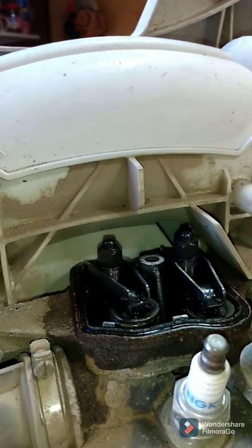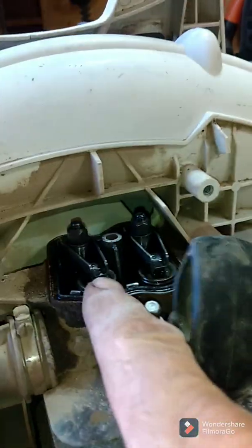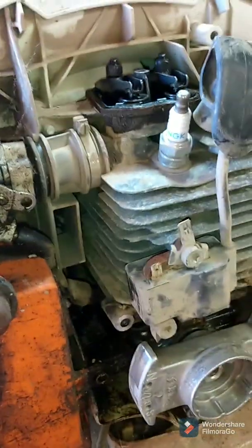Isn't that funny? I have to go through and adjust these bad boys, but yeah, this will probably end up being a runner. I just got it in with zero compression — that's the first thing you go and look at. I'll go back and set these valves to about five thousandths each, go through it, do the carb, and she'll be a runner.